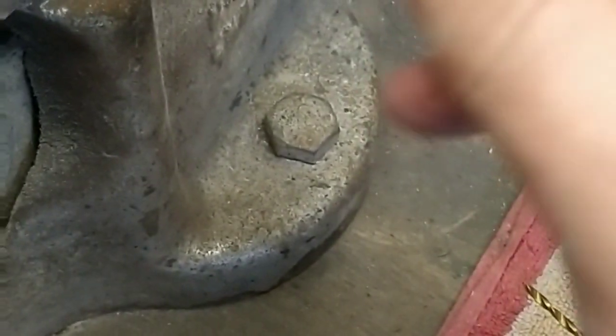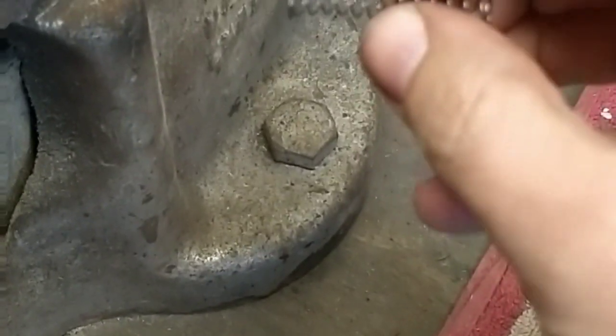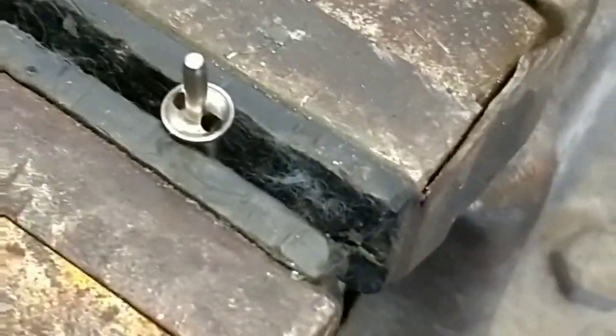It fits very snugly over the valve, and I've flared the end slightly because it's just a little bit less diameter than the original spring, and I don't want it to poke out the end of the housing. So I'll show what it looks like when it's all together, and we're going to give this a go now to see if I can ream those holes a little bit wider.